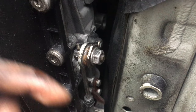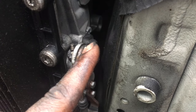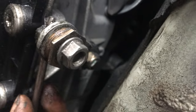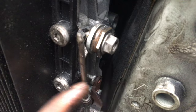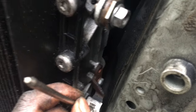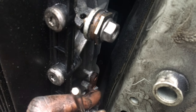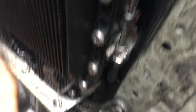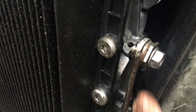The shift linkage is located on the driver's side of the car. I'm gonna go ahead and use a 13 millimeter and take this bolt off right here first. You just have to loosen this bolt — you don't have to take it fully off. All you want to do is just get the tension off of this rod piece right here. Now we're going to use a 10 millimeter and get these two bolts off right here. With this bolt loosened and the first bolt taken out, I can go ahead and just take this piece off — you just slide it out. Then pivot it down a little bit to get access to that second bolt in the back. An easier way of doing this would be to drop the transmission down a little bit by taking the mount off and lowering it down on a jack, which will give easier access to those bolts.